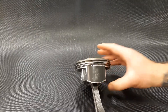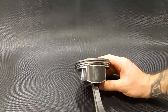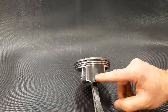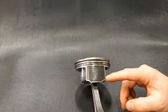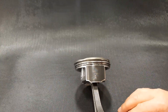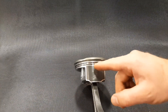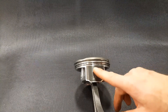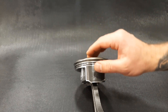Next I want to go back to the skirt and look for scoring. A little bit of light vertical scuffing is totally normal given the up-and-down reciprocal nature of the piston — contact between the slipper skirt and the cylinder wall is going to happen. What I don't want to see is a large amount of deep gouging or scoring. I don't want to see anything moving on a diagonal path or in a zigzag pattern, as that would indicate a bent rod.